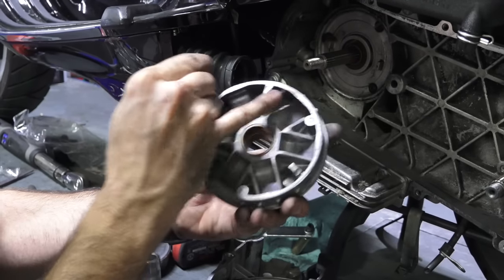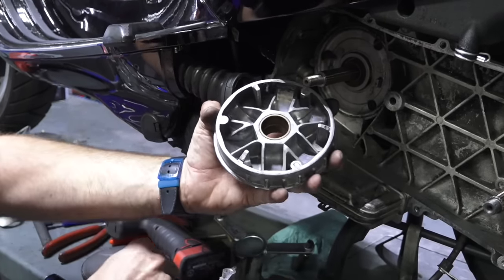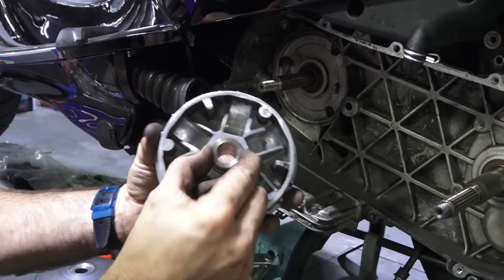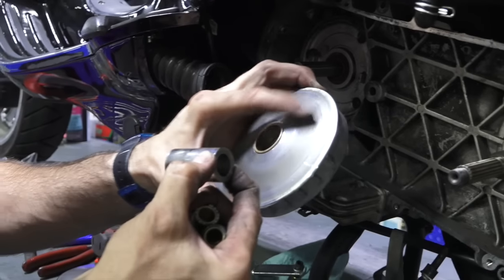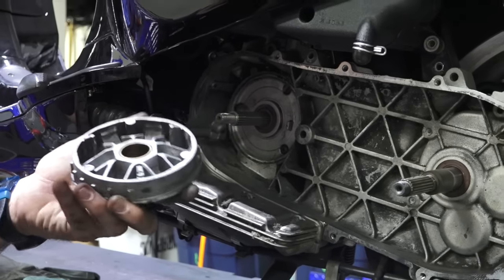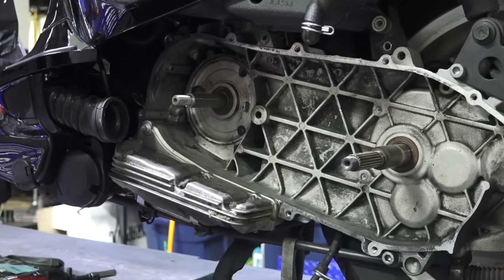Make sure all the cages aren't scored or damaged — sometimes the metal part of the roller will come out and damage them. There's a specification for the bushing: put the pin in and it shouldn't have hardly any rock, just sliding freely. This pulley is still in good shape — no ridges. Maybe at 30,000 miles it would be a good idea to change it, but it's definitely reusable. Clean up the belt mess, go through the driven pulley and clutch, and start bolting it back together.